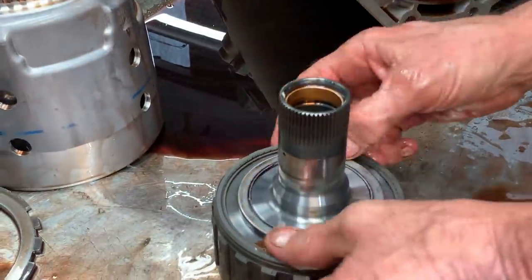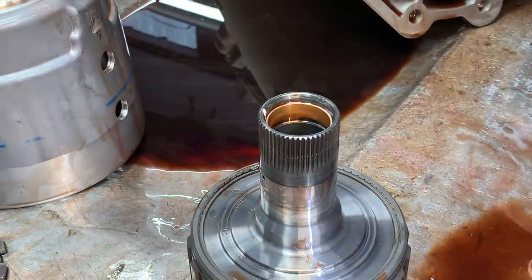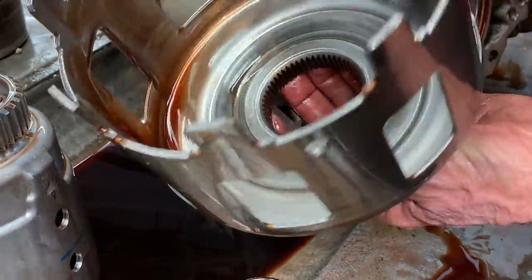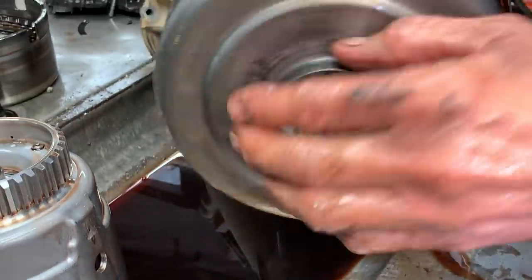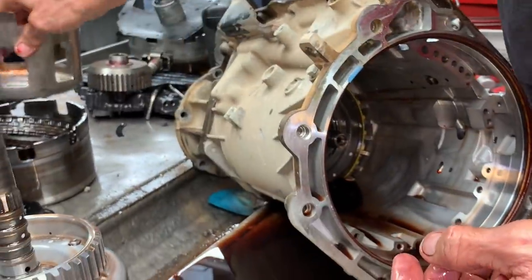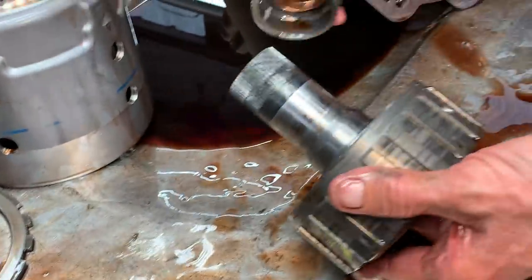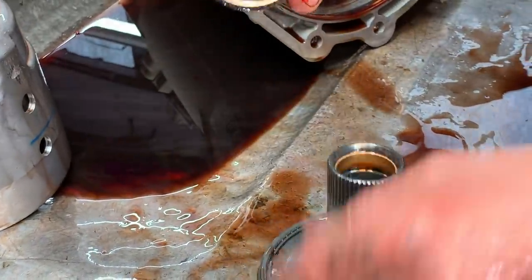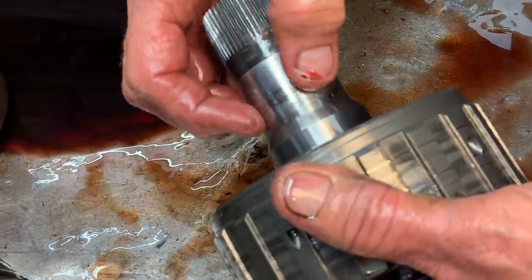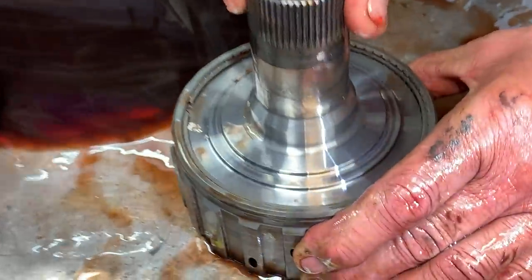So we do have our roller bearing hub here. Get my shell out real quick. Just a stock shell. Almost look like GM might have started heating some of these up a little bit more. Those look a little bit different color. It'd be smart. Yeah, you got your sun gear here. Rubs on here. We just have that single bushing right there that rubs on here really hard, but they harden this so much you don't see any wear here anymore. We used to see tons of wear. But you can see now, look how much wear we have in there.